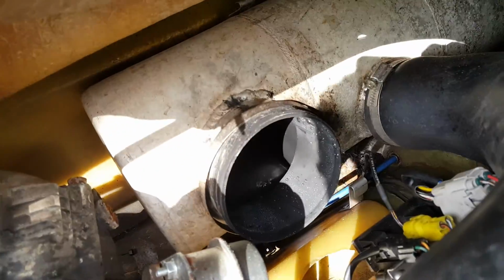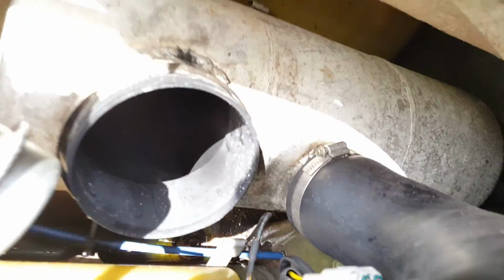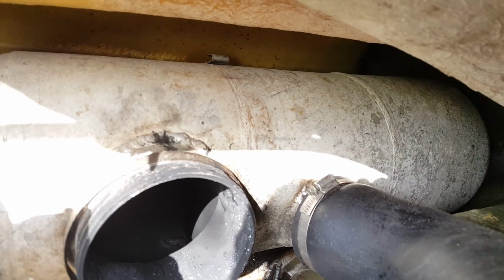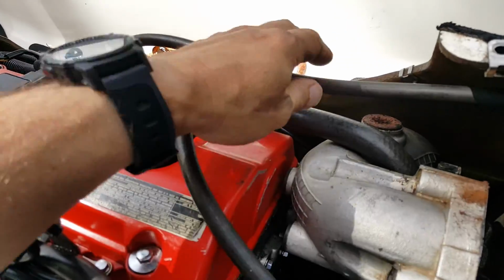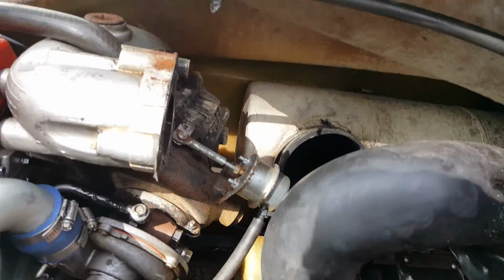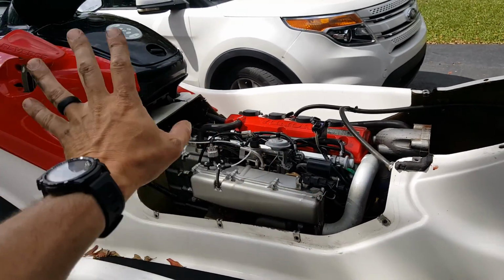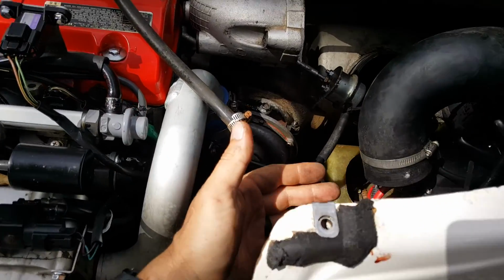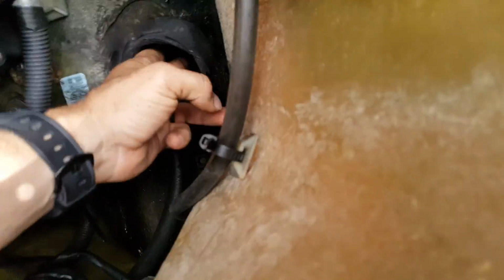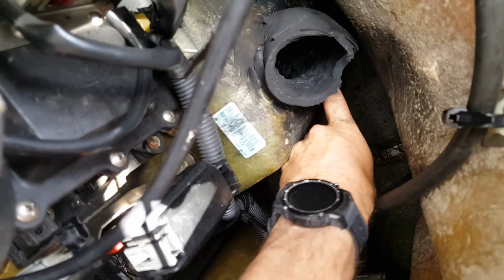That box has a very little amount of water. I'm not sure how much you guys can see there, but there's a very little amount of water. This should have more, and that's the problem there. I am getting water coming out of these lines, pressurized. It's got good pressure. So I did not get any overheating codes from the engine. It just pretty much just bogged down, and the carbon dioxide smoke coming out of this hole in this pipe over here, which maybe you can see. Look at my finger over there. That's actually from the outside of this hole here.